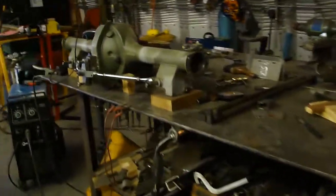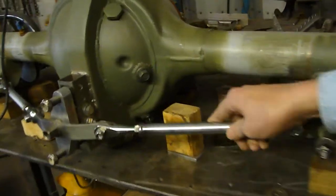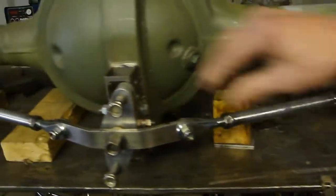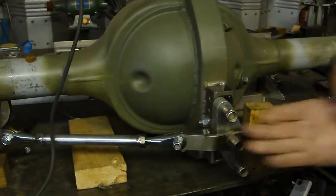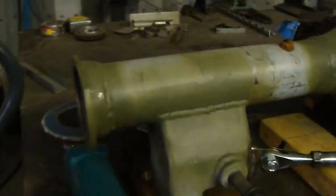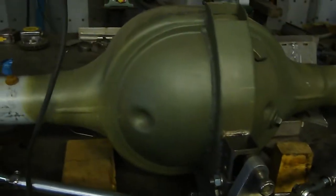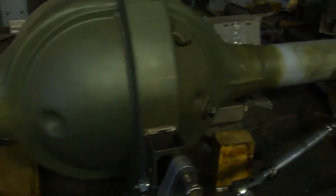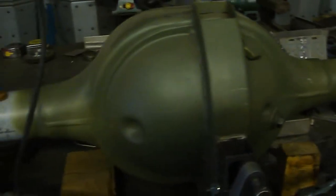The next step is right over here — the rear we just added. I needed to add this brace to the Watts link, because it was kind of vulnerable to bending, so I'll put a brace on it. It's also adjustable up and down, which is why there are clevises on there and not just a welded bracket. But the rear is ready to go. The brakes are done, the mounts are done, the axles are narrowed, everything's done. It's ready to be cleaned up, painted, and put back in.